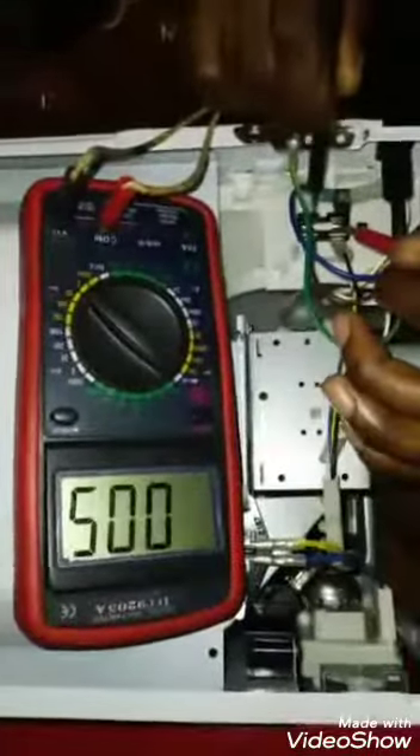Remove the cabinet. We'll put on a multimeter and set it to continuity. If you get a reading, that means the power fuse has not blown. The power fuse has been ruled out.